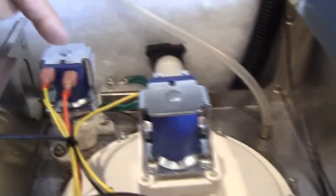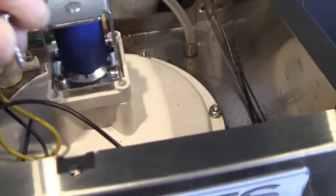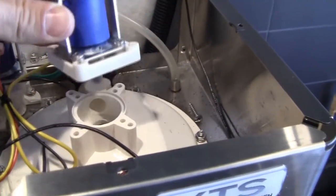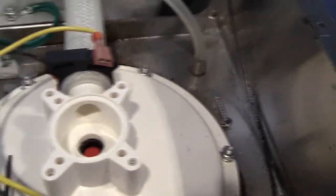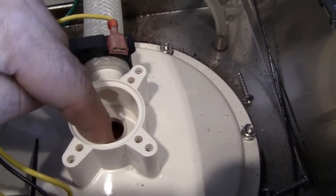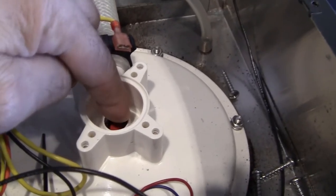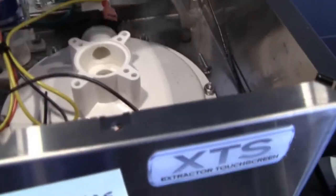This is the right hand brew valve and this is the right hand bypass valve. These are held in with four screws located in the four corners. I've already pulled off the electrical connections for the coil of the solenoid valve for the right hand brew head. Down here is the seat — where my finger is. You want to make sure there's no calcium buildup there, and don't be too aggressive when cleaning it because you want this seat to be perfectly flat to make the best seal possible. This is where the leak is actually taking place — the part that's not closing properly causing water to leak down into the basket.